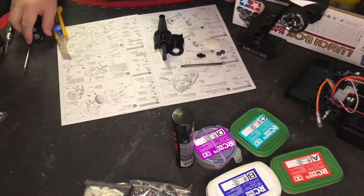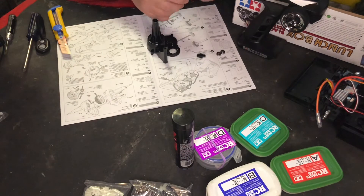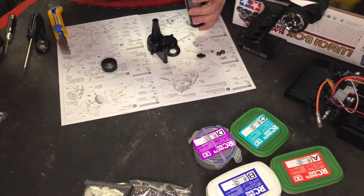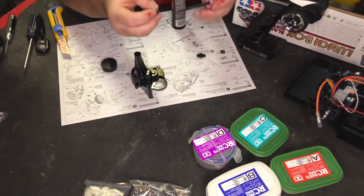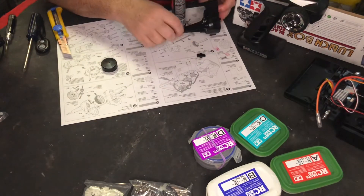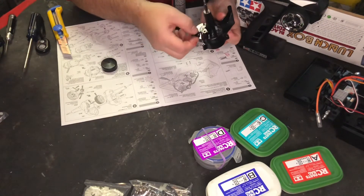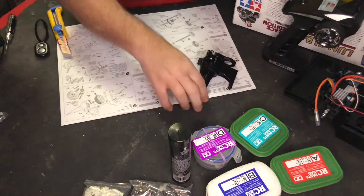I've got everything I need for step six. Start putting it all together. This rod here needs to be greased, and so does the gear that it goes through. I'm using farm and truck grease — I don't know of machinery that works harder than farm equipment does. It says to use BD7s, but instead of BD7s we are going to be using bearings from Fast Eddie. Seat the bearing. Now we're going to put the oil cap on — it's this little plastic piece. One side goes over the little nipple that sticks out, the other side gets the screw. And that just about does it for step six.